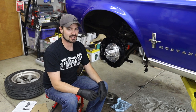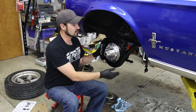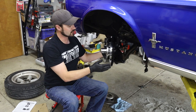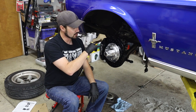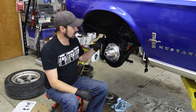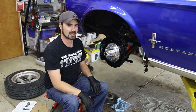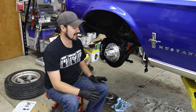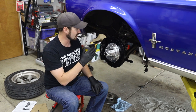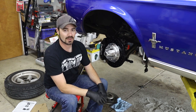But by far the biggest issue with this is the fact that once I had everything here and I was testing range of motion, you have range of motion until you try to turn out. The upturned end of the strut rod running from the front of the car back to the control arm smacks directly into the steering pickup of the Maier Racing part. I have absolutely no idea what configuration change could be made to make that not happen. It seems like you just cannot use that upturned control arm or the upturned strut arm with this.